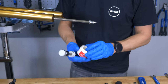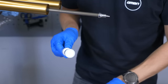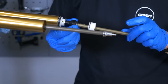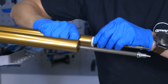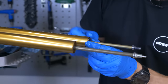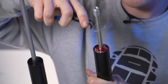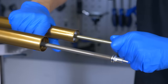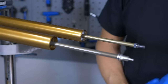Everything is clean and not damaged, so apply just a small amount of grease on the component, the same on the quad seal, and the same on the O-ring around the bottom — just enough to enable it to pass freely. Carefully slide it back into the leg, making sure it passes in smoothly with no hindrance. On the Fox fork a washer goes on first, then the retaining clip. On RockShox you'll need circlip pliers. Once it's back in, you can see it's fully extended, confirming there's no problem with air in the wrong place.